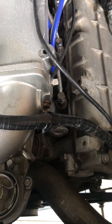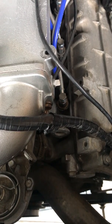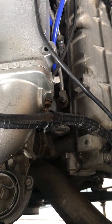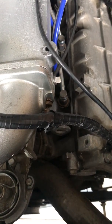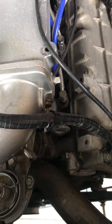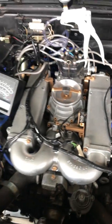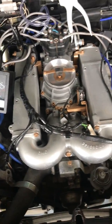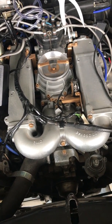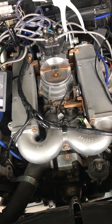At this point, the engine is warm. Usually when it is not warm, as soon as I start the engine, I'll get idle hunt for probably a good 30 seconds to a minute before it settles back down to a fairly even idle. It always seems to rest at about 775, but the engine itself is just lumpy. There's a vibration to it, and no matter what, I can't figure out exactly what's going on.